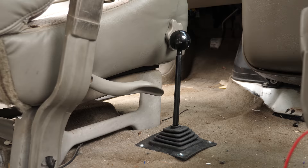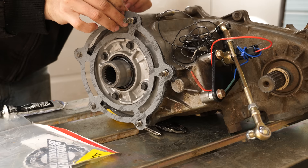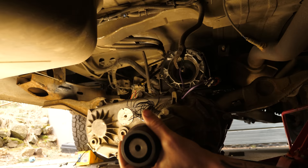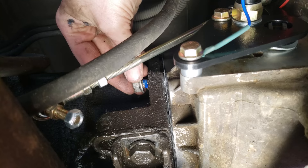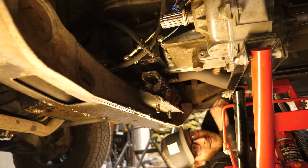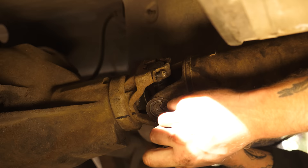We're getting super close to being done now. The next step is to get the transfer case back in. We'll put a small, even amount of gasket maker on both mounting surfaces of the transfer case and the transmission. Since the case has the studs, we'll put the supplied gasket on here to keep it from moving as we muscle this thing back into place. Lift the transfer case back up with the jack — the trick is to get the main output shaft of the transmission to line up with the transfer case first, then the studs will follow. Once it's slid into place, add and tighten the four exposed nuts in a star pattern to secure the transfer case. Now we'll need to lift and remove the transmission mount again and attach the last hidden bolt. Make sure all hardware up to this point is torqued down properly with some Loctite. We can also reinstall the rear driveshaft at this point — be sure to match up the marks you made. We'll leave the front shaft off for now because we'll need the working room.